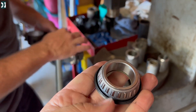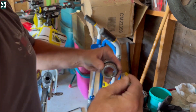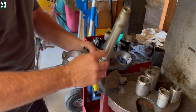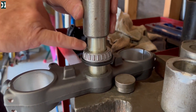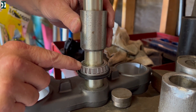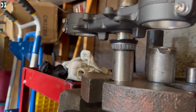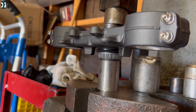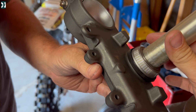If you don't do that it will feel funny when you put it together. Just put a little grease on the bottom bearing, and before you do that make sure which one is the bottom — you need to look at both and establish that this is the bottom and the other one is the top. You always push on the inner race on the bearing, never touch the bearing itself — it should always be free-moving. When you press it, that moving part should always be free. Super easy job if you have good tools for it.